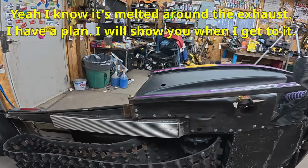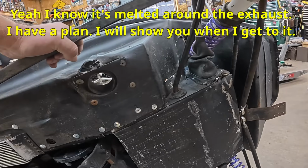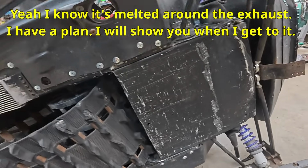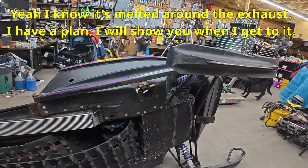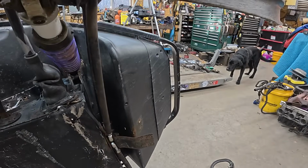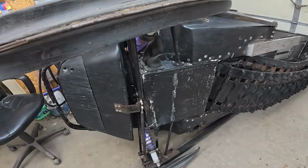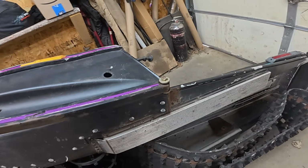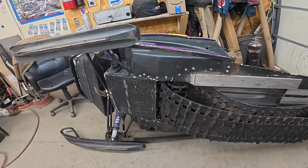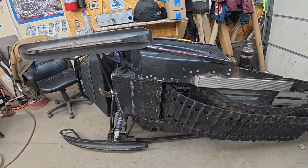Well, it's coming along. I didn't even have to drill all the holes in this side. A bunch of them lined up. A couple were actually okay on the other side, too. Got to give it one more flip because I didn't fully rivet the bottom side, the side that's down now, and then rivet from the inside. Oh yeah, take care of that strap up there. Then we ought to be pretty near done with the belly pan. All right, there's all the rivets from the underside, at least all I know of. We got that strap attached all along the bottom, attached to the trailing arm brace. I don't know, that's about it. Both sides are done. Now to get the ones from inside the pan.